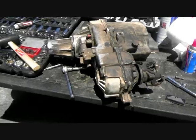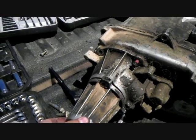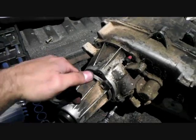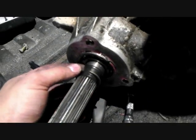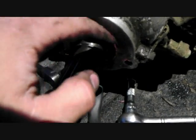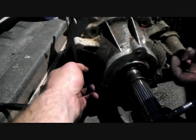So here we have the transfer case — it's a 93 YJ, transfer case is the 231J. I'm going to walk you through how to take it apart. Once you get this part right here — it's a little guard — unscrew the three bolts holding it on, then snap it off in a clockwise direction. We had some difficulty getting it to go clockwise, so just a sharp tap with a rubber mallet broke it off. Just make sure you don't scuff up any of the sealing surface. Then there's this little ring that goes in this little groove — it's a beast to get out. We put two screwdrivers in that section and pried it apart, then wrapped a screwdriver around the inside. Now we're taking out the bolts that connect this part to the base of the transfer case, and then we'll be able to pull that off.